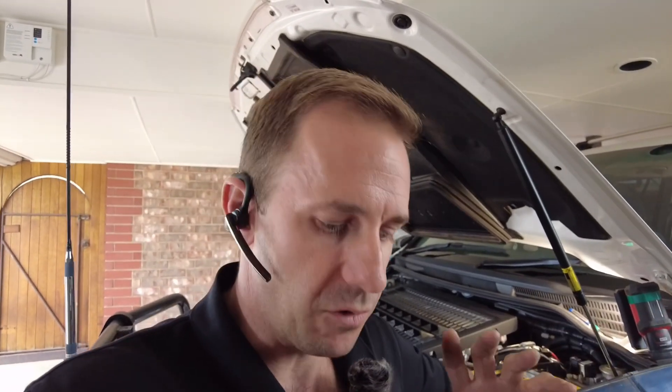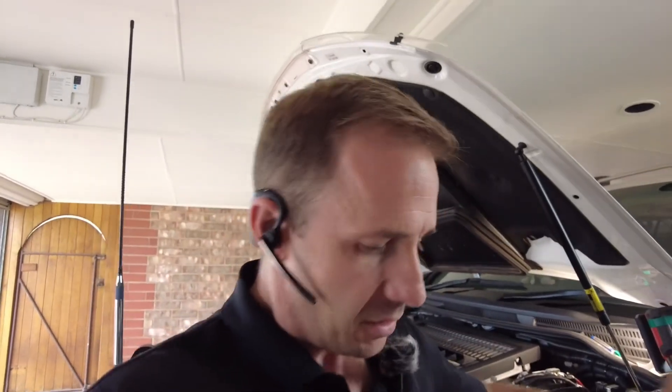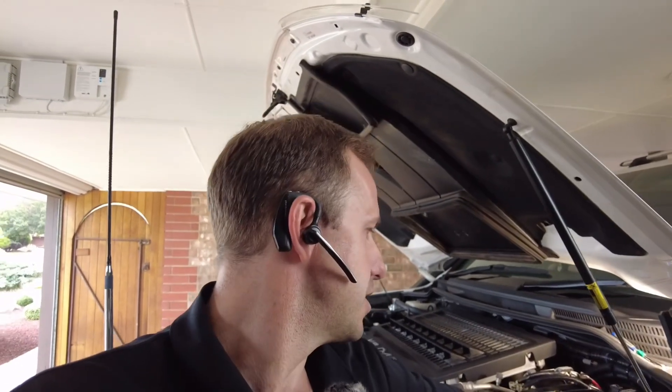Having the correct wiring done on the vehicle to suit the van is so crucial. It's so common that people upgrading vans encounter this problem and buy adapters that just get them by. Our mate has to keep pulling the Anderson plug on his fridge line — which will wear it out — every time he pulls over, or he has to physically go into his van and shut the fridge down. What a pest. Camping is supposed to be easy. When you've got the system wired up correctly, you will not have any issues — guaranteed. When you understand the systems properly and can interface vehicle to caravan correctly, you can travel this country and you will never get a flat starter battery from the caravan's draw. Everything is isolated, everything shuts off and just works as it should. So I'm going to set these guys up properly, spend a few hours here and set you up.